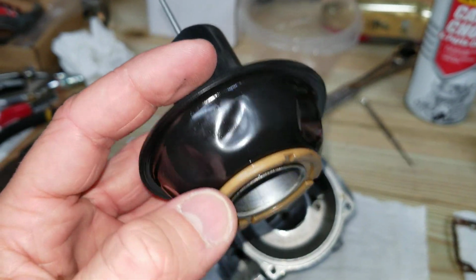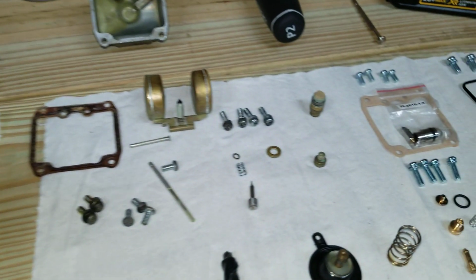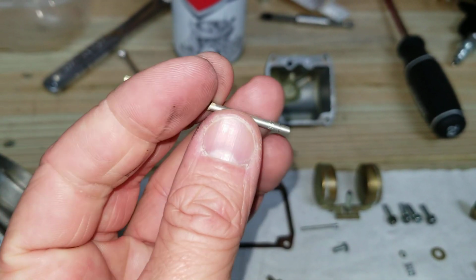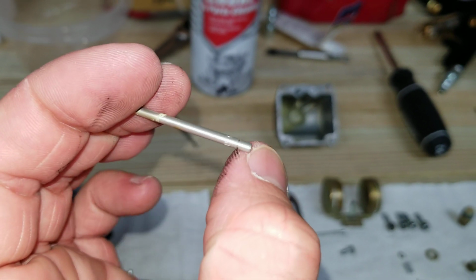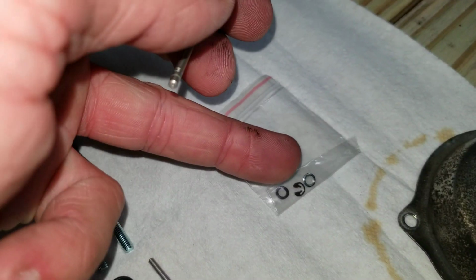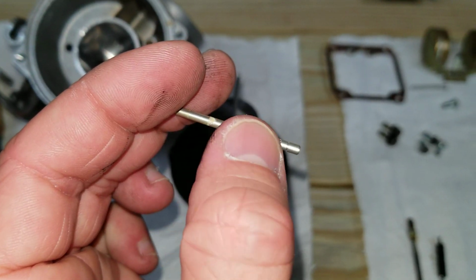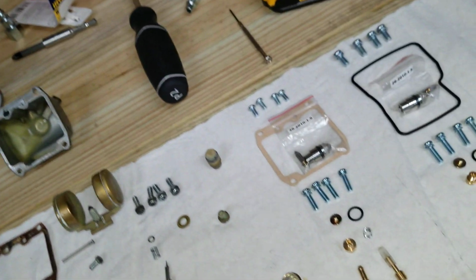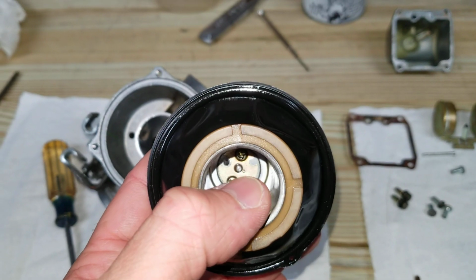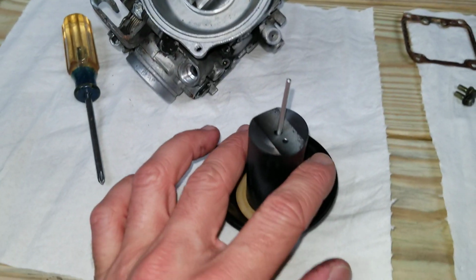And then once you have this whole assembly out, you kind of wipe it down, take those 2 screws out, take that plate out that's in there, and then you can replace the needle, which looks like this in the kit, and it's numbered. There's a part number etched in there, and there's a little ridge that a C-clip, which they do provide for you in the kit, goes down in there. You clip that on there. There's a spacer that sits on this side of it, and then there's a washer that sits on the other side. You slide that down along with the spring that sits below. There's a little channel at the base of this beneath that plate, and I probably should have recorded a video that shows you that, but you can kind of see it here.